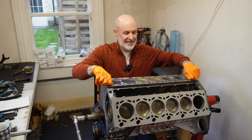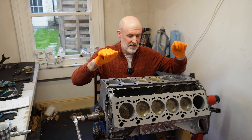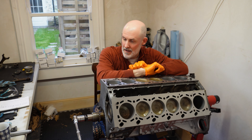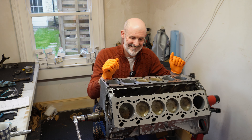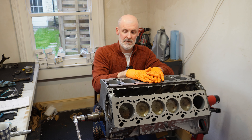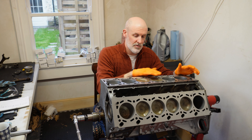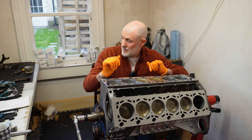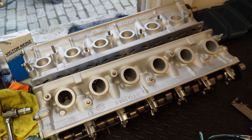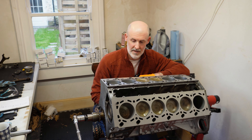Welcome to a new video. My V12 block for my E31 850i is still here on the stand. Things haven't changed much since the last video - the main reason being I can't assemble it; it's a lump of junk. I believe the machining done on this block is substandard and as a result my piston protrusion is way out of spec, so the engine can't be assembled as it stands. I've received my refurbished cylinder heads and head gaskets, and the next step would be to plant the head gaskets on, stick my heads on and start assembling - the whole bottom end is done, as I covered in the last video.